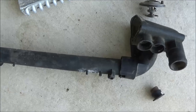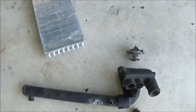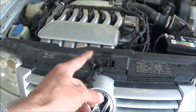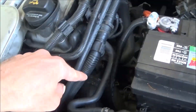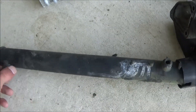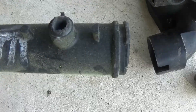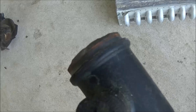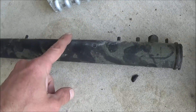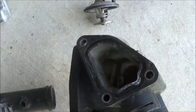The next problem you're going to have is the coolant flange and the coolant tube. The coolant tube goes this way — really hard to access — and the coolant flange is right here connected to all these hoses. The problem with the coolant tube is the ends just crumble away, so you can't just put a new O-ring on because the end is gone. I upgraded to an aluminum coolant tube and replaced the coolant flange with another plastic one.